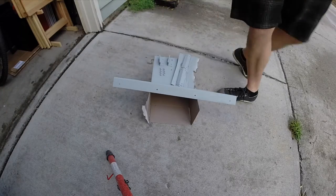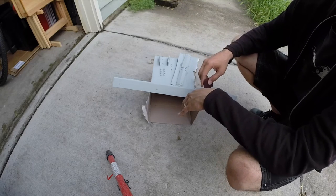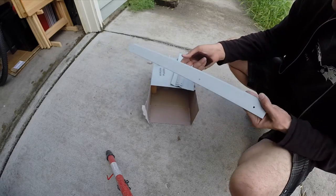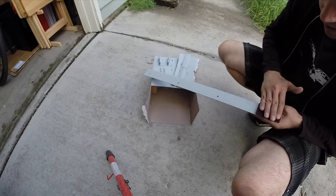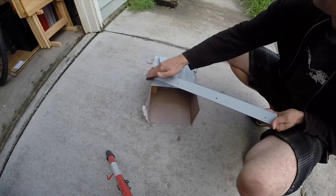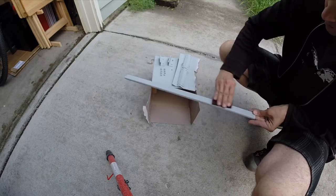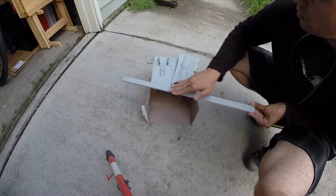The rain has passed; it's still pretty warm out — probably close to 75 or 80 — so I'm going to go ahead and lay down some paint. First thing I'm going to do is take the red scotch pad and knock down any slight bumps that might have come up from the primer. Give the primer a little tooth. Main thing: just make sure it's nice and smooth by lightly going over it with the scotch pad.